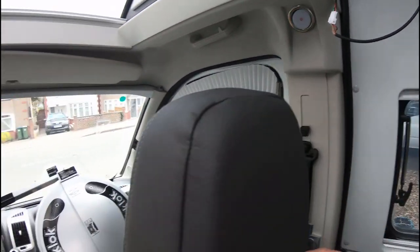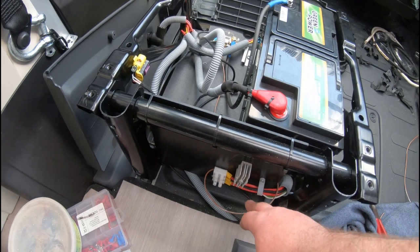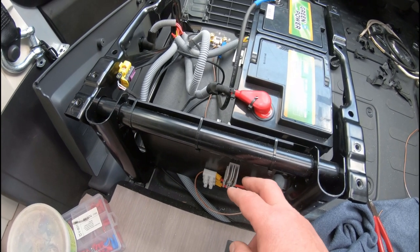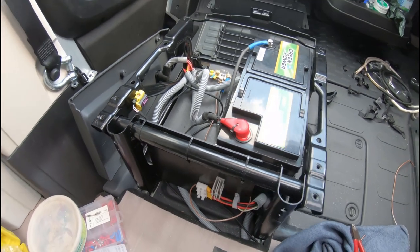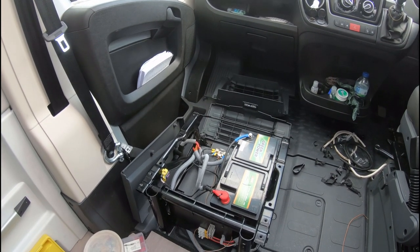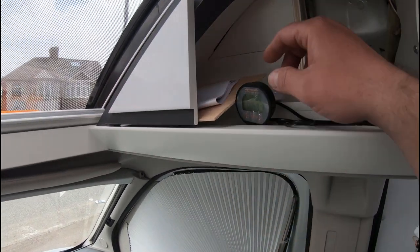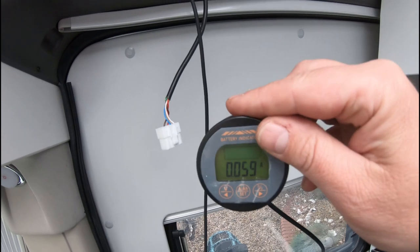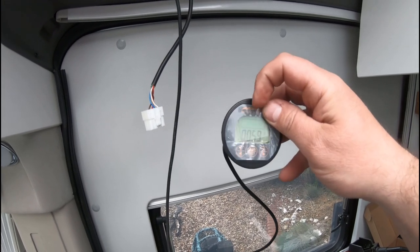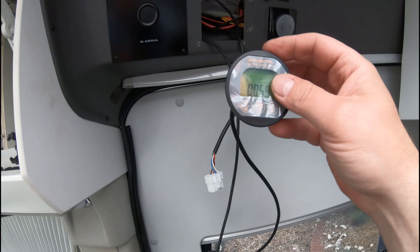I've finished making up the plug through the panel - a bit more awkward at this end because it isn't quite the right plug for this connection, but it fits tightly enough. Worst case you might have to solder each cable individually and heat shrink over them. I've pulled the B-positive brown cable through and connected it to the positive terminal - this is only temporary because I need to get an inline fuse on this which is on order. I'm doing this just to make sure the system works before putting things back together. The negatives are connected across the shunt to the battery, the positive gives power supply to the gauge, and the gauge is plugged in - it's showing 0.06 of an amp.